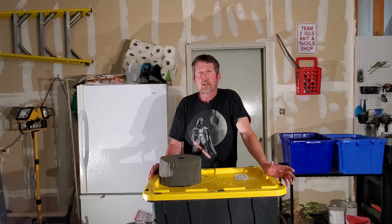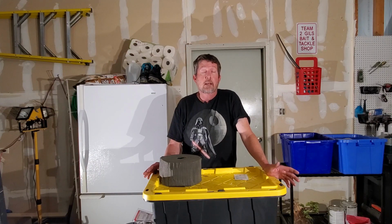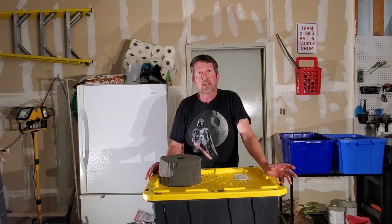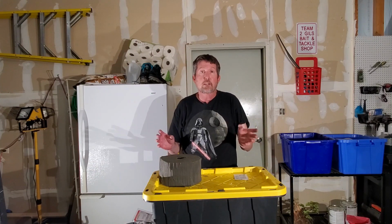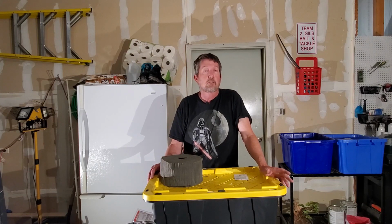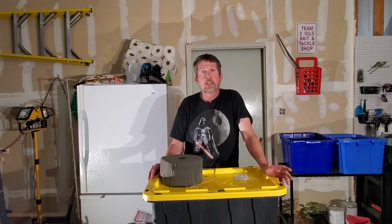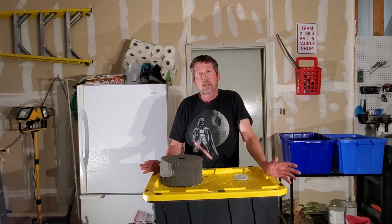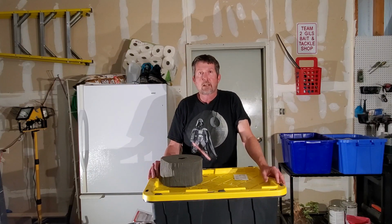So this is something, if you have caster adjustable like mine, I've got Hausers. They're quick and easy. You can make simple, quick adjustments to them in a couple minutes. So if you've got a high-speed track, you can adjust it a little bit positive. If it's a slower one, you can adjust it more negative. Or again, just set it and forget it, whatever's up to you.